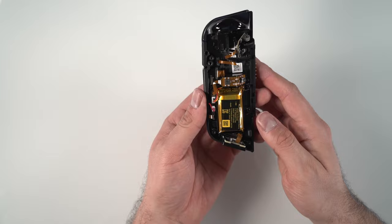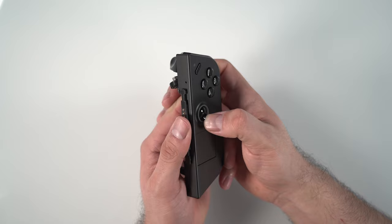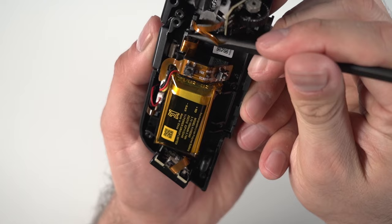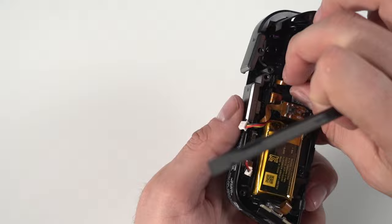Remove the joystick cap by gripping it firmly and applying pressure outwards — it takes a little more pressure than expected but it'll be fine. Next unplug the cables — there are seven total; start with the battery and use a plastic spudger to loosen the tabs. Just like the left side there are tabs to lift straight up, so use a spudger because it's tight in some spots. Once all tabs are popped up, pull the cables out. Make sure all clips are up before pulling, and keep your spudger handy in case any accidentally fall back down. Ribbon cables are sensitive so be gentle.